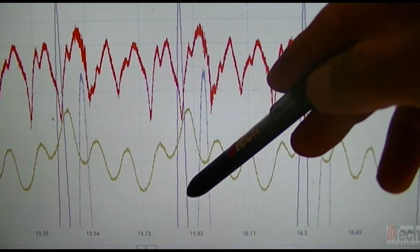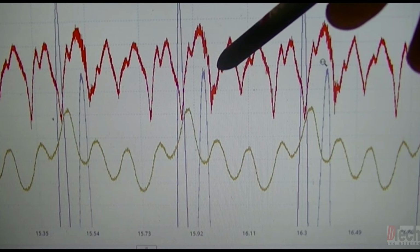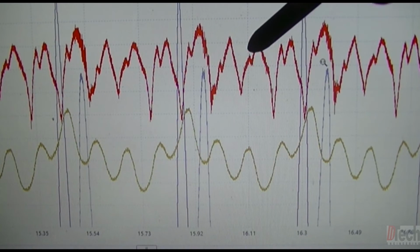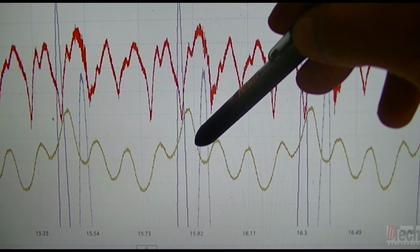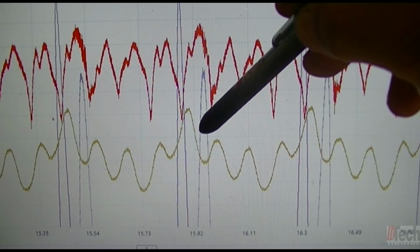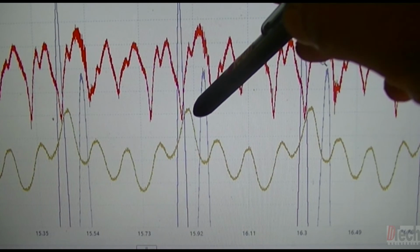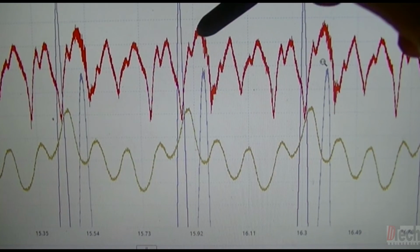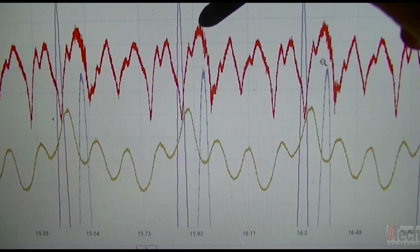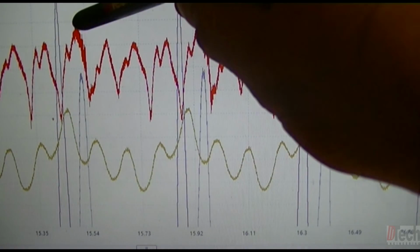And that is because on compression, instead of switching over as normal coming down, the piston is being pushed up into the cylinder, and it's feeding what would be pressurized air, or pressure, out the exhaust. It's coming out, and you're seeing it there at the end of the tailpipe with a higher peak point in the exhaust trace.